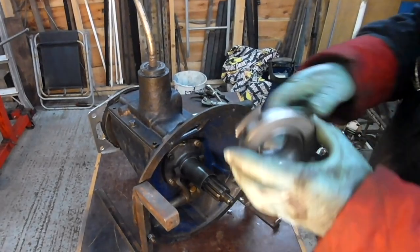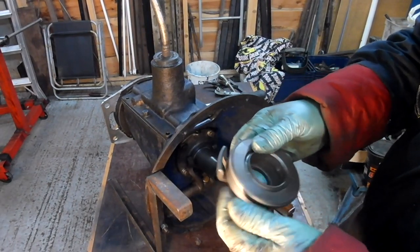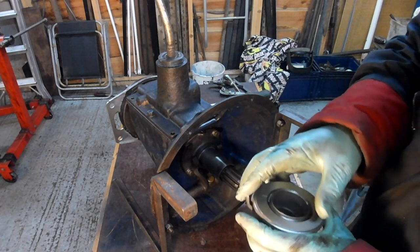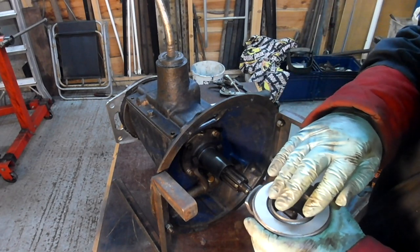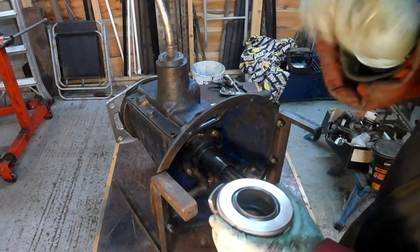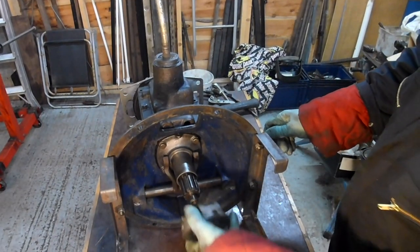And here's the release bearing. This is a new one. After having that noise on my truck, I thought I'll put a new one on instead of just trying to use the old one. I took the old one off and I took that hammer, with a soft face, and I just gave it a couple of taps there, holding it in my hand like that with my finger underneath, and it just went through, and this one just went on just as easily. So that goes on there like that,